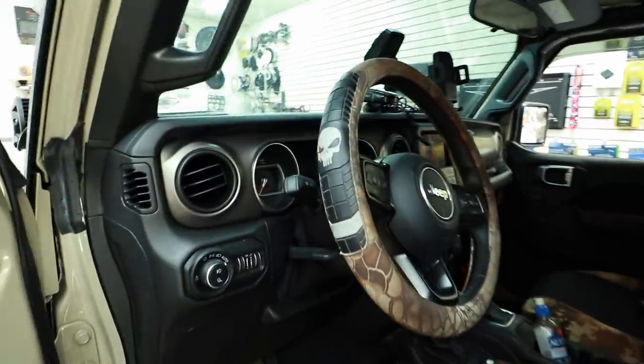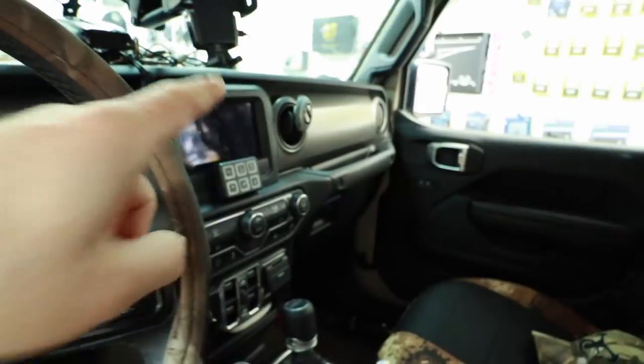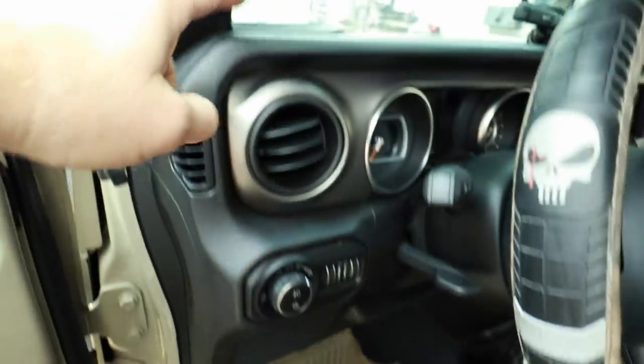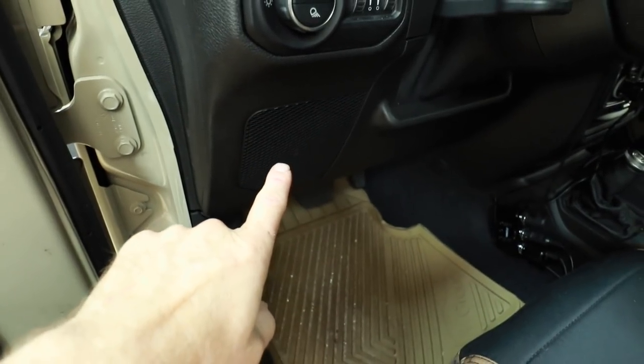If you haven't had the pleasure of checking out the interior of one of these new Jeeps, it's definitely an improvement over the previous model. They all come with video screens in the dash of various sizes and they have eight-speaker systems. There's a set of three and a half inch speakers up here in this factory grill and a set of four inch speakers down in the side. Why would they do four inch? They figured out a long time ago with the four-by-sixes that they needed to upgrade to six and a half, which the JK thankfully has had for years. This model they decided to switch it out to a four inch.